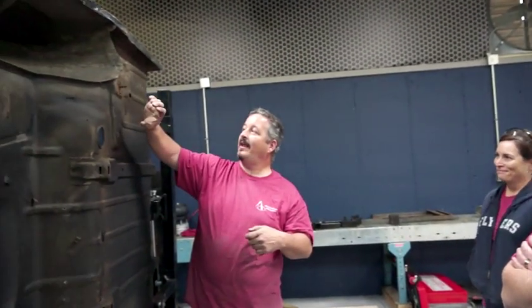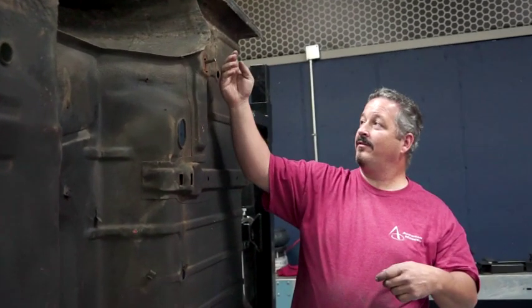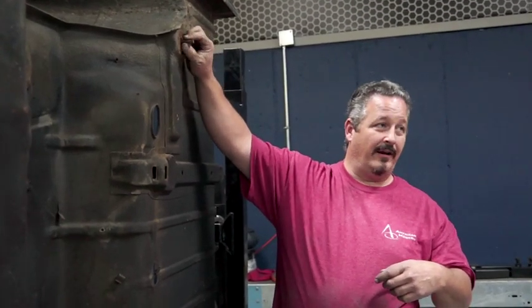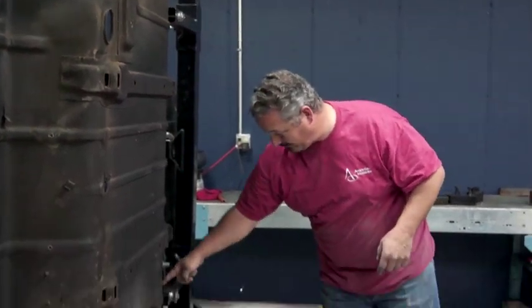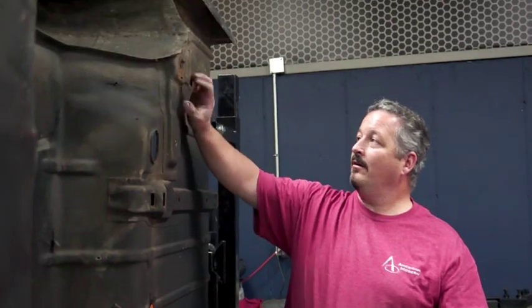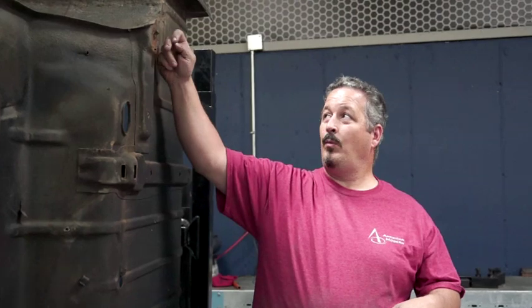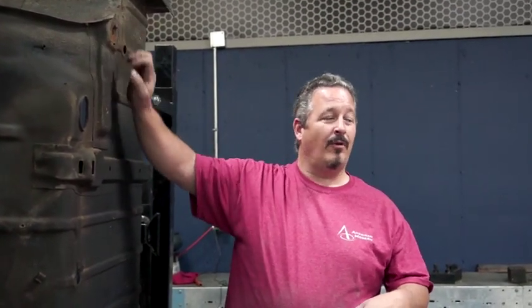So we are going to cut the metal here, down here, across here, and up like this — take that out. This bolt here had a bolt head on the end and we cut it off. It's rusted solid in there. It used to be able to just screw right in there, like these — you just bolt right in. So what we have to do is take that out, fabricate a new piece of metal, take a nut on the opposite side, weld it on, then put it on there and weld it all the way around, grind it smooth.